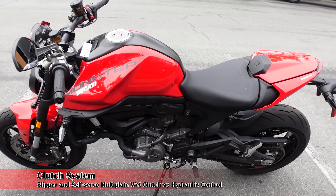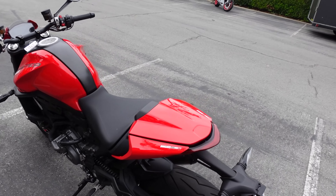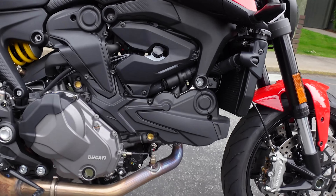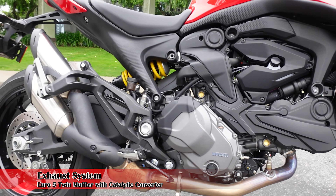Let's move over to the front and talk about the new front brakes. We have 320 millimeter front dual rotor brakes with the new monoblock 432 front calipers attached to steel braided lines, which is very nice, all the way up to a Brembo master with fully adjustable in and out levers.